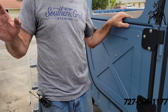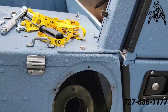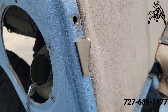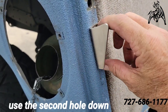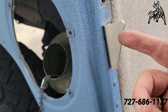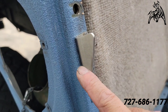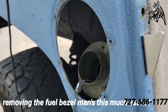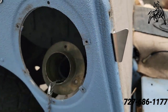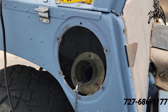I want to bring you around to show you the striker. Like I said before, they are side-specific. This is how you want this to look — with the machine screw bolts on the inside, so your latch hits this correctly. Your fuel filler bezel coming out makes it so much easier to get to the back here. And because I have an aluminum door that I've been wanting to put on for two years, today is a perfect opportunity to take care of that as well.